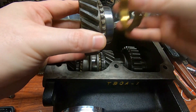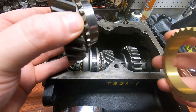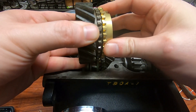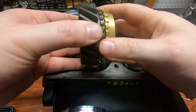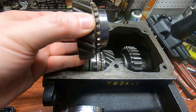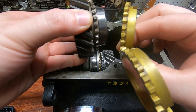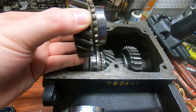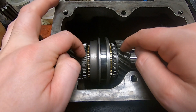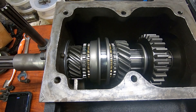And you press down and it grips just fine. Since blocking rings are generally pretty inexpensive anyways, here's another brand of blocking ring which has an even smaller gap, but it's still pretty dang good. When you put pressure on it, it grips just like it should. The difference is that these are Crown, the damaged ones are Omics, and what came out of it originally was also Crown. So what it comes down to here is that I either have gears that are just not in spec, blocking rings that are not in spec, or a combination of both.